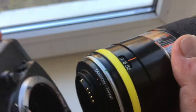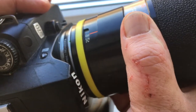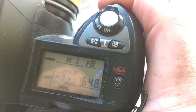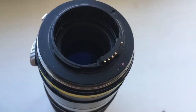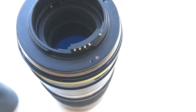To reinstall, combine the middle contact and red dot on the adapter with the white dot on the camera. Very carefully insert, turn counterclockwise until it clicks. The camera will show aperture again. Gently insert the lens with adapter and chip into the camera. I wish you good pictures and good shots — thank you for your attention!